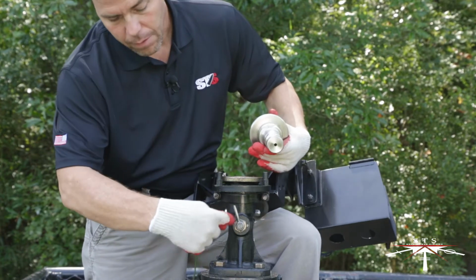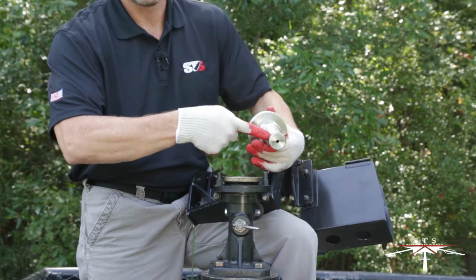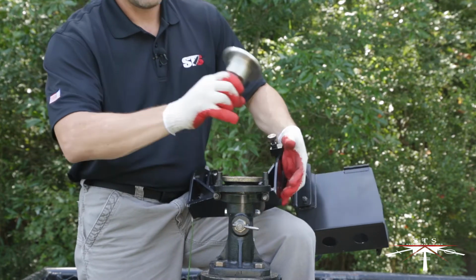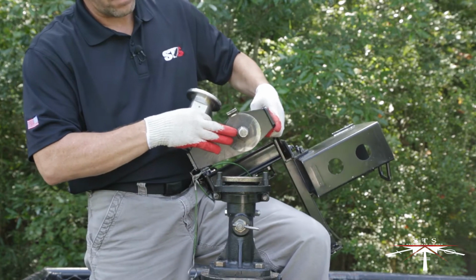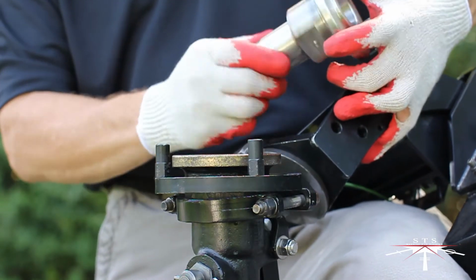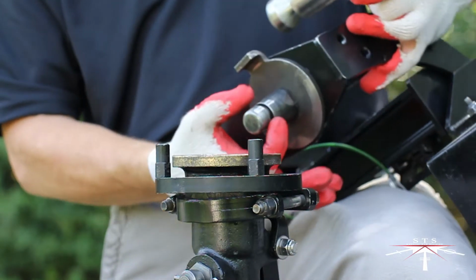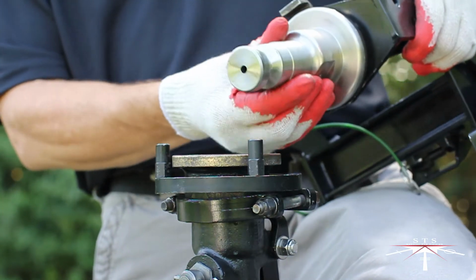The front end here, as I rotated it down, has a pin that goes into this area and locks the reducer into place. And then in order for the reducer to lock onto the small pintle, right here where my finger's pointing, you actually take these little Allen screws on either side and tighten them down, and they lock into position, making your small pintle into a large pintle.